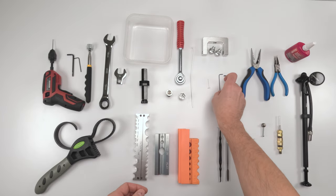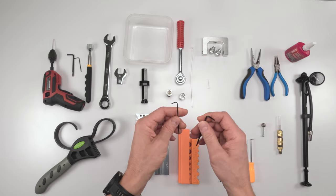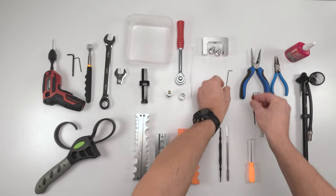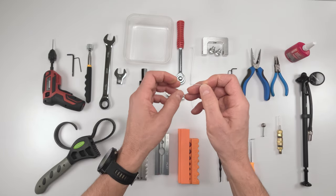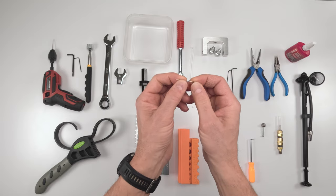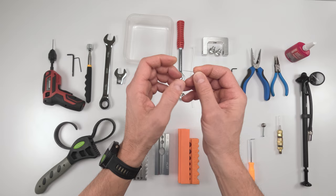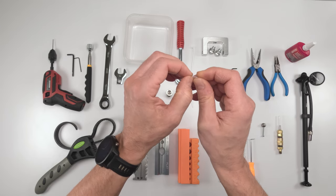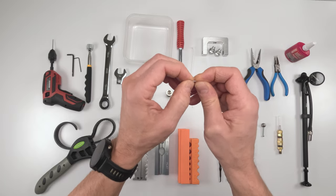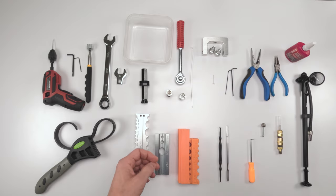So from that point on, we're going to remove the, actually, before we do that, we're going to work on the inner shaft first. To take out the seals in the inner shafts, we need a pin, preferably one a little bit longer. 1.5 inch would be great. This one's a little bit too short. It's all I can find right now. But solid, make sure it's not a floppy pin. Make sure it's a really solid pin to be able to go in there and pop out the seals inside the lifting plate shafts.